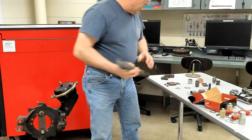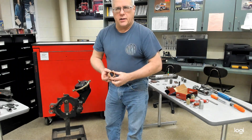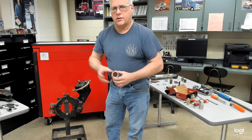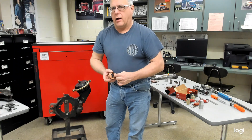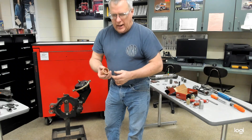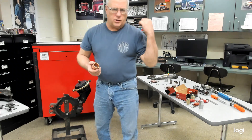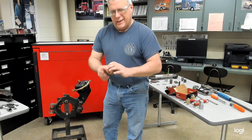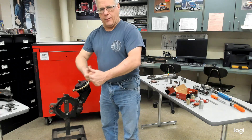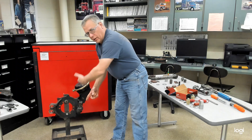With S-cams comes bushings. If you're putting an S-cam in, you're putting new bushings in — that'll get us to the minimum radial play. Usually made of nylon, as you see here. Believe it or not, these are hard when compared against steel; the steel wears as much as the nylon bushing. So we always replace it. Take a bushing driver, knock them out — you usually have to knock from one side to the other, so knock them both out.